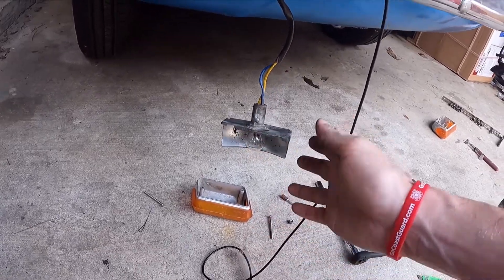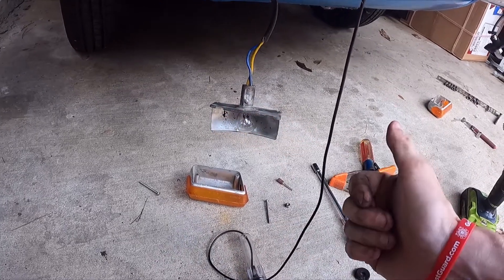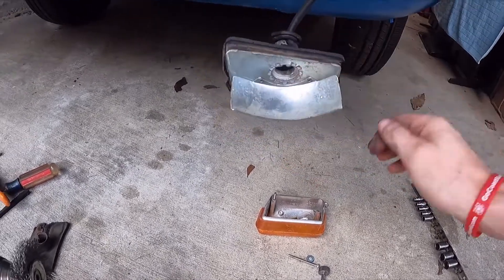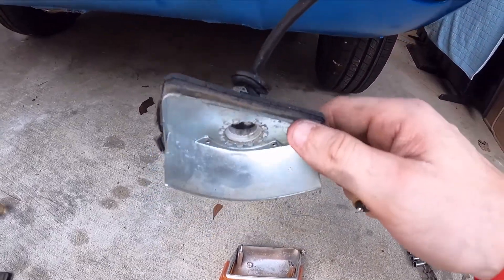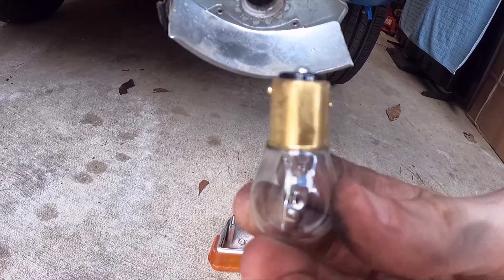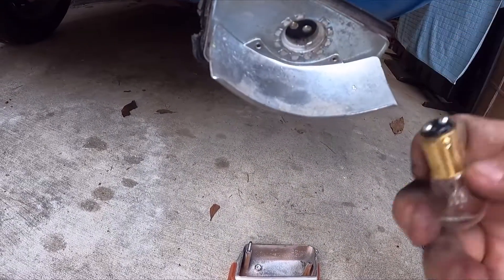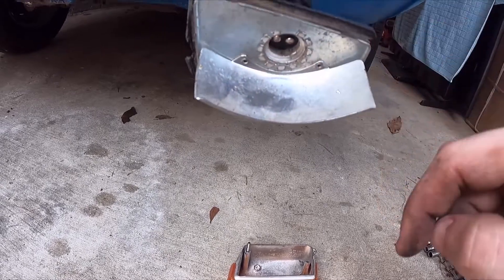So as you can see, we finally got the blinker working — that's nice. Now I cleaned the grounds. But there's one thing I did notice — I'll show you on the other blinker. The two prongs in there have to be aligned a certain way. On the inside there are these two nubs, and that's what lines up with these on the bottom of the bulb. So if these two nubs are not lined up with these, they're not going to make contact and flash. There's a certain orientation that the bulb goes in — it goes in and you have to twist. If these are not parallel so they touch, and you have them up and down, they're not going to make contact. Make sure these are lined up in the correct way, otherwise you're out of luck with the light.